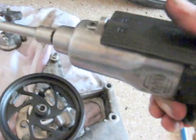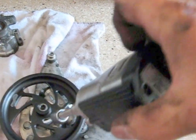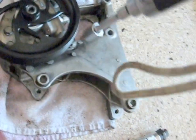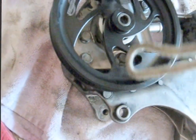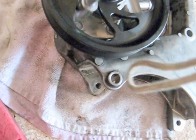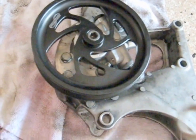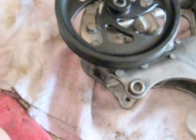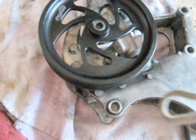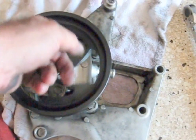I have a little butterfly air tool that I'm going to use to spin these on. I can set this to very light torque so it's almost like spinning it on with my hand, because I certainly don't want to cross-thread anything here. Then I'll use that same socket on my 3/8 drive torque wrench and set them to 25. Alright, we're all set on that.